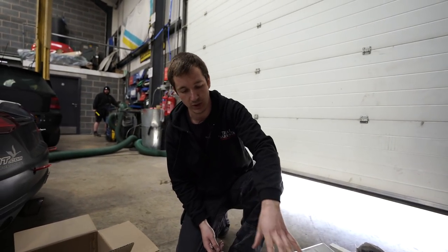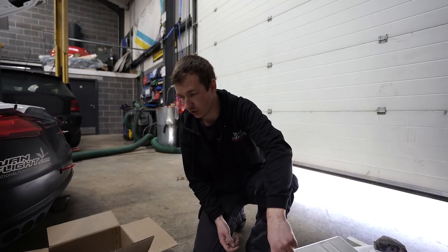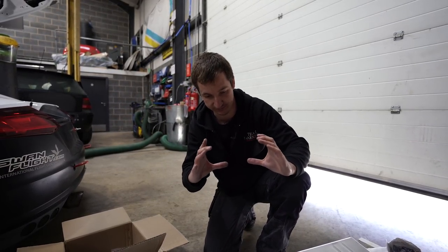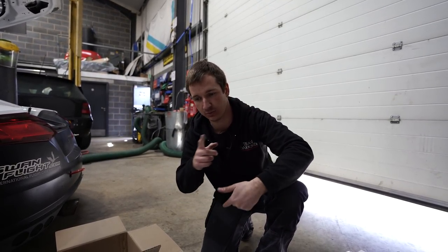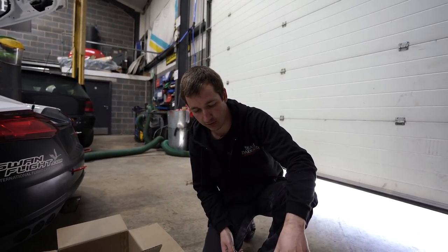But we're doing things a little bit differently. So what we're going to do with that is it's going to go to a dry break connector next to the fuel cap. And that's going to have a dry break that goes to the tuff jugs, which then lets the tuff jugs breathe, which we'll demonstrate later on, you'll see. So we've got that sorted.